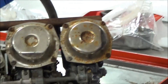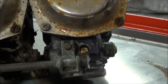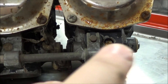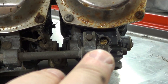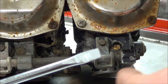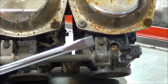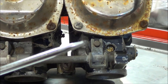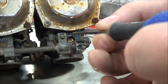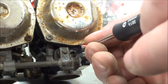Now that we've removed the Welch plug, we're ultimately trying to service these carburetors. You don't just take the screw all the way out — we want to do what's called baselining, seeing what that screw was set at. Danny's going to thread a screwdriver in and count half turns, or what we call flats. Watching in the camera, you can count it in quarters once you get to the bottom. The screw ends up being set at three quarters of a turn.